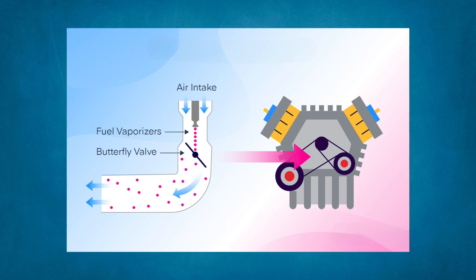Understanding the butterfly valve and how it works with the throttle is an important concept. The observant among you will have noticed something. While the carburetor is a Venturi, a similar effect can be observed around the butterfly valve too, as the airflow narrows and is restricted there also. This means that icing can form in two places within the carburetor: within the main Venturi itself, leading to air starvation, and around the butterfly valve, leading to degraded throttle control.